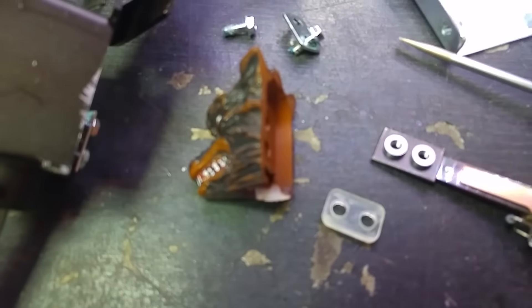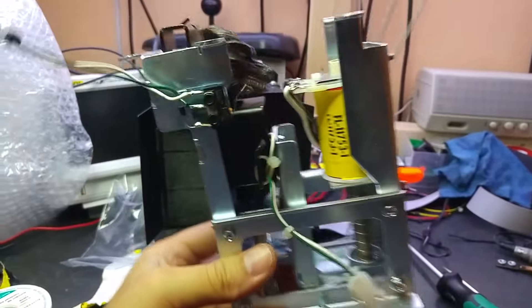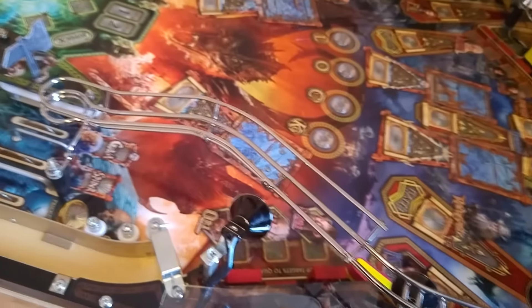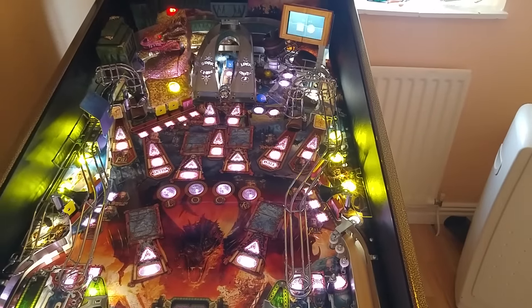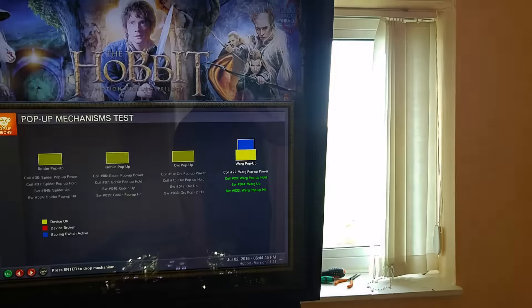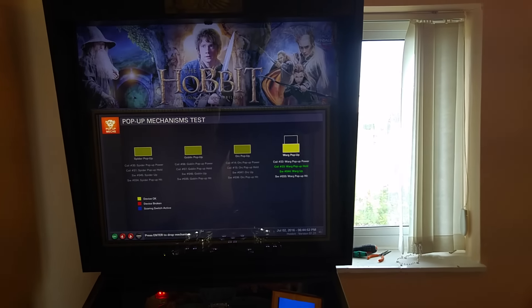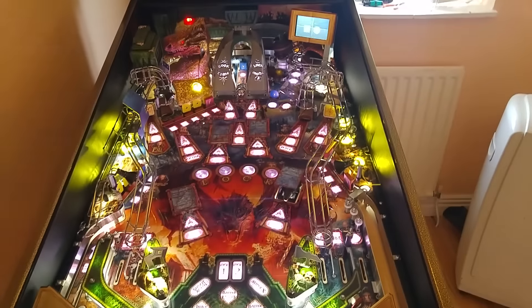You'll need a spare set of those if you're on a Hobbit. With the coil sleeve and switch replaced, we can see it's now working freely, so we can reinstall it in the game. Installed — now we can re-enable it and test it. In test mode, let's test the pop-up — there you go, it's up and holding, and the target switch is registering. That seems to be working fine. Let's make sure it's not registering vibrations anymore — and it isn't, so that's good. We can give it a play test in game.